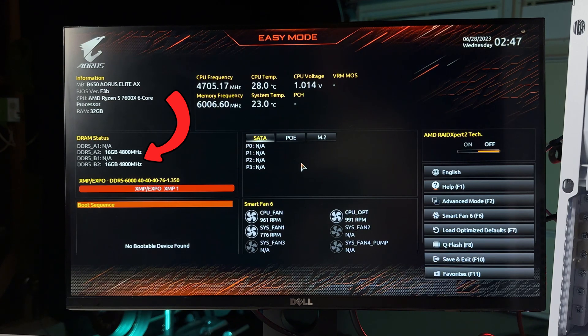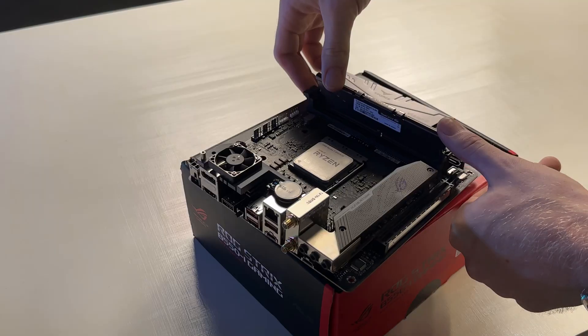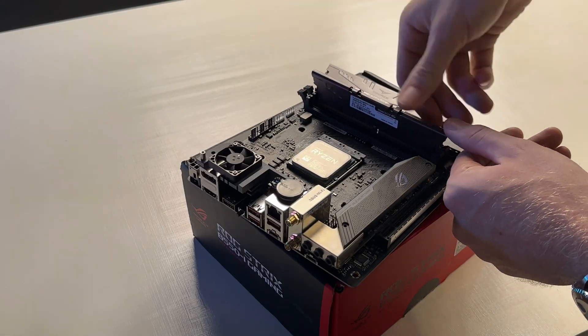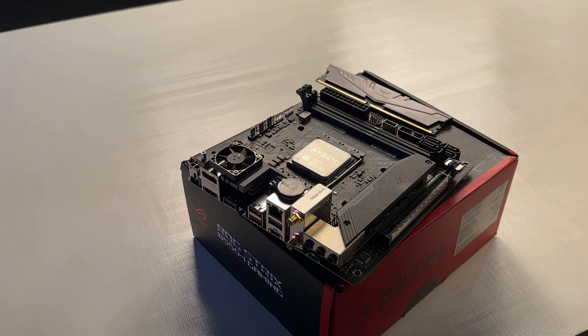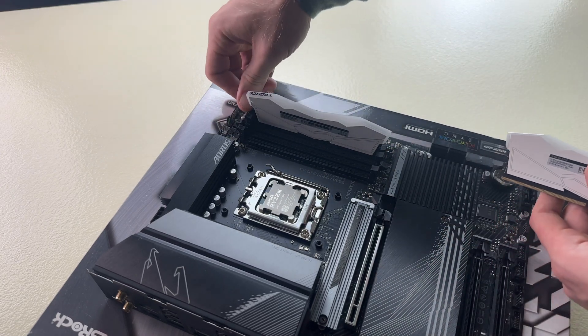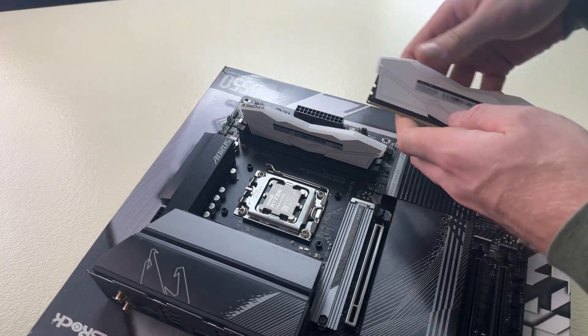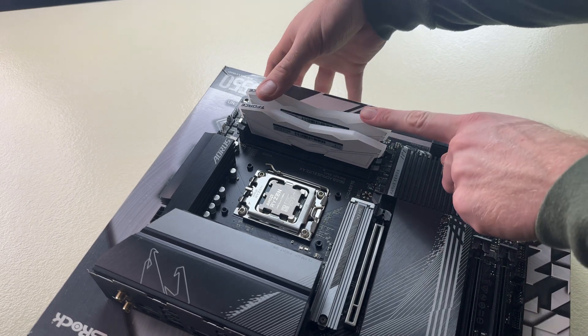Next up in the BIOS, check to see that all your RAM shows up. If you bought and installed 16 gigs but only 8 are showing up, that means something's wrong. In this case, turn off your computer and try reseating your RAM — in other words, unplug your RAM then plug it back in. If it still doesn't show up as expected, try plugging the sticks into other slots. So if you originally put them in slots 2 and 4, move those sticks over to slots 1 and 3.